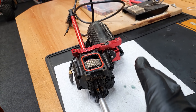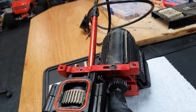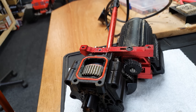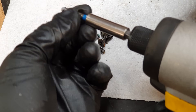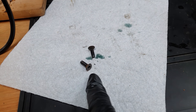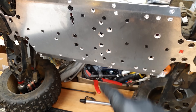Now we can get it back into the transmission, remembering the red side towards the motor. Motor mount cover back on. When greasing gears, I grease enclosed gears because no dirt gets in, but leave exposed gears dry — if you grease exposed gears the dirt sticks to it and turns into a grinding paste, which is worse than leaving it dry. Also, don't put Loctite on screws going into plastic — only on screws going into metal.